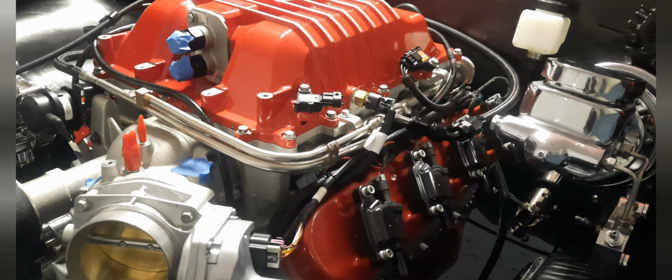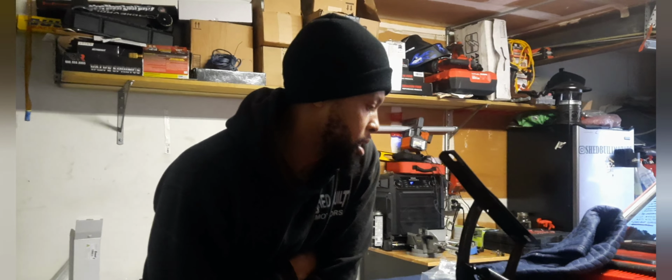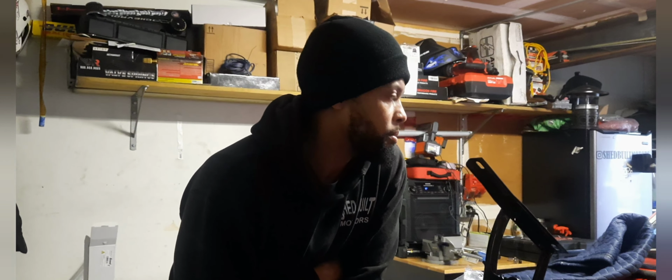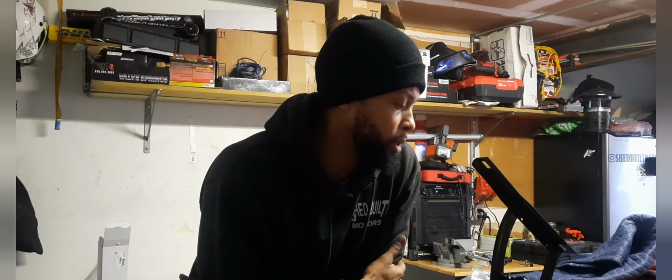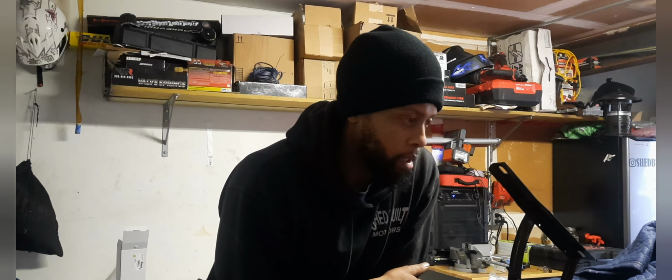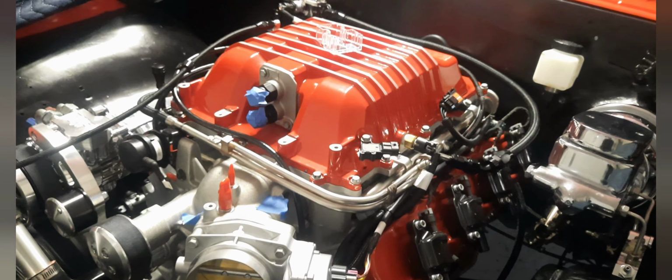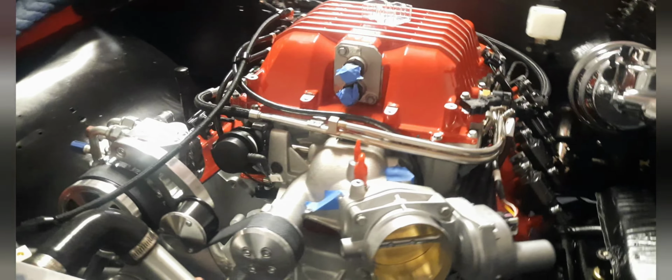It's already got a 12 bolt with 373s and a posi, limited slip. It's a T56 6-speed transmission we put in this one, so he's shifting gears the whole time. That's a stick shift then. Yeah, so that's why we're still trying to mount up all the T56 stuff now. You've got a reservoir, clutch brackets and all that, clutch pedals.